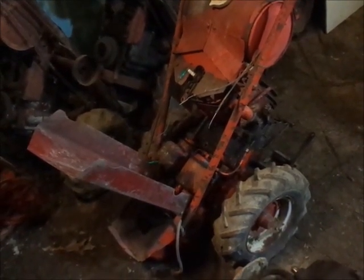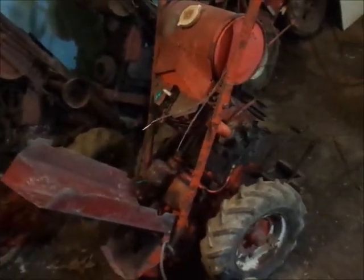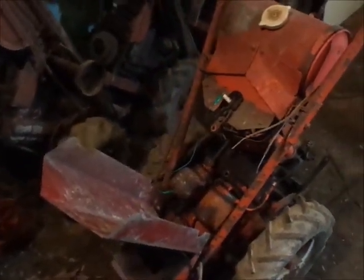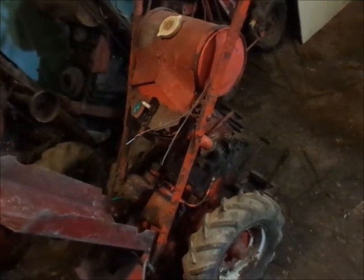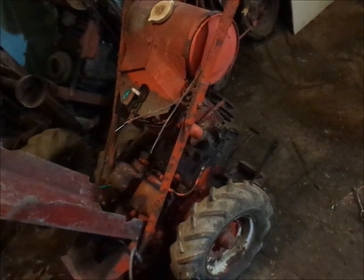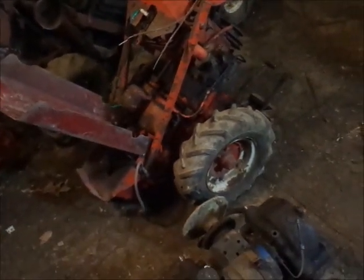Just a thought I have, but anyhow, without further ado, to get this motor off is not really that hard. I'm going to do the same thing as normal. The only thing I missed, and I'm glad I looked, is I have to take the air shields off around the intake and the exhaust, because obviously those go around the intake and the exhaust, and guess what? Fan shroud is going to tilt forward here. So, anyhow, I'll set you guys up on the tripod and watch me wrestle this motor off and stick it on this trans.